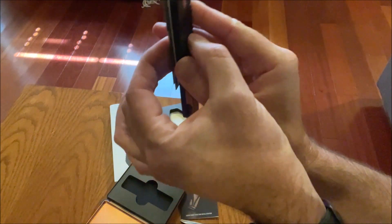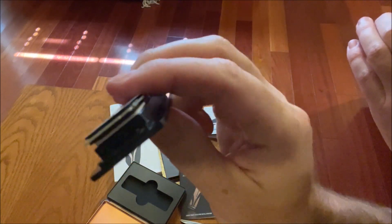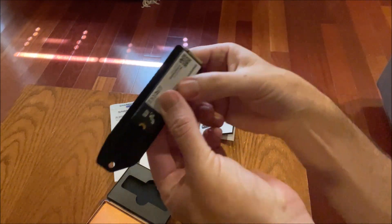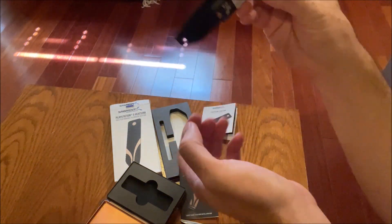The issue is that Sony recommends that the heatsink go underneath the heatsink cover inside the PS5. It should not be more than 11.25 millimeters, with no more than 8 millimeters above and 2.45 millimeters below the SSD for the heatsink.